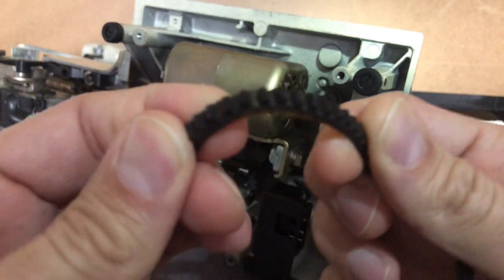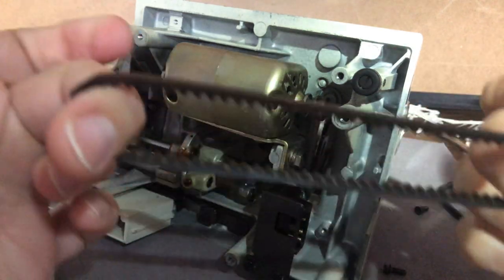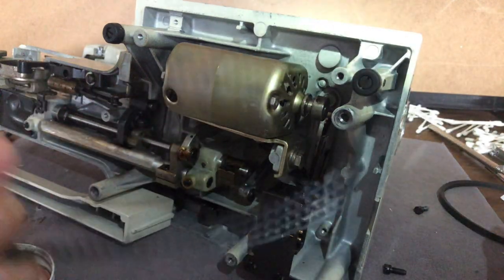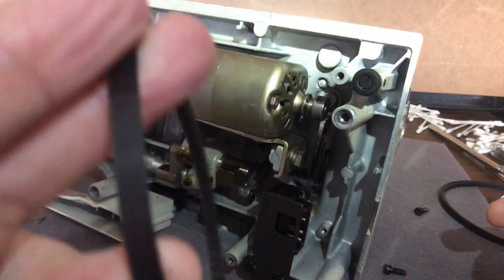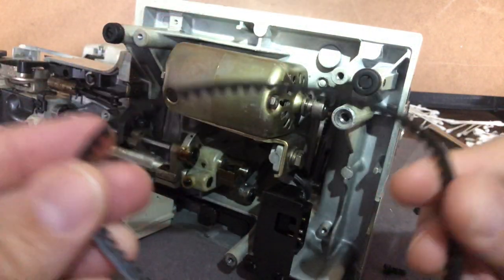You still have the lugs on this side. Is this belt broken? No — you can even stretch it and it holds. This belt could run easily another year or more, but I am going through the machine and fully reconditioning it, and this is one of the things I consider necessary. You want to go ahead and replace the belt.